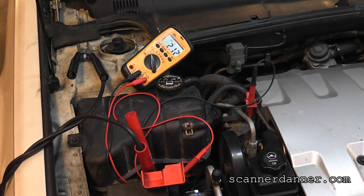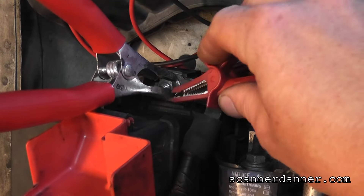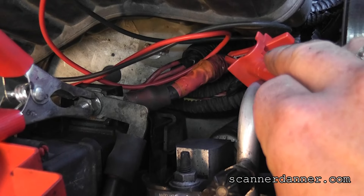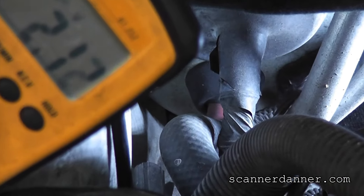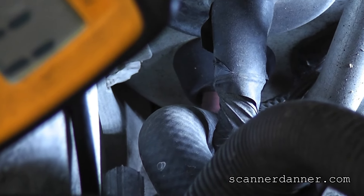When we saw that, we actually had four volts and the starter was kind of working — I couldn't totally duplicate what we had. When we saw that four-volt number at the distribution box, we started backtracking the cable. We moved the lead up to the stud and got a measurement — still low. We were concerned about the main feed coming in from the battery in the back. We did measurements down the cable, still low, and then started going in toward the firewall. Down below the main harness there's a big heavy red cable, and we measured right there — still low voltage, about four volts.